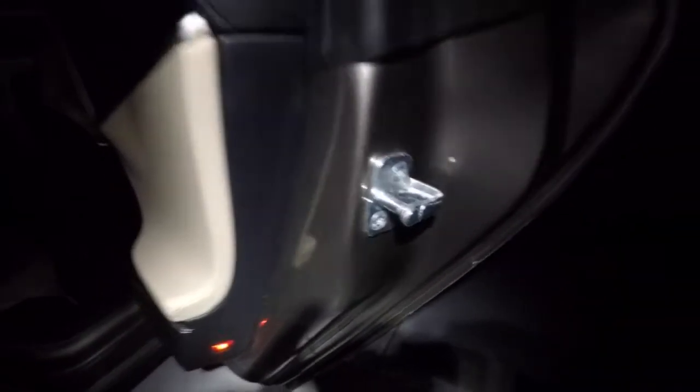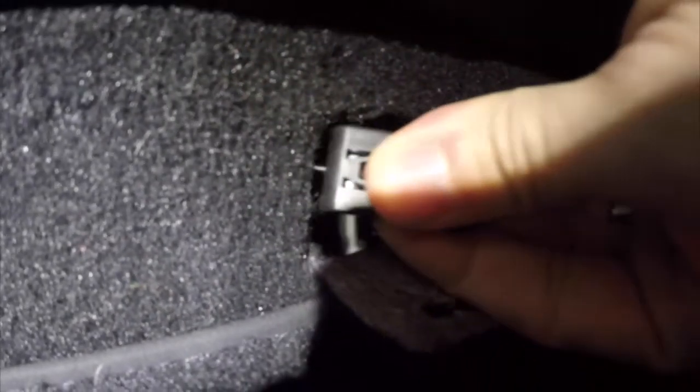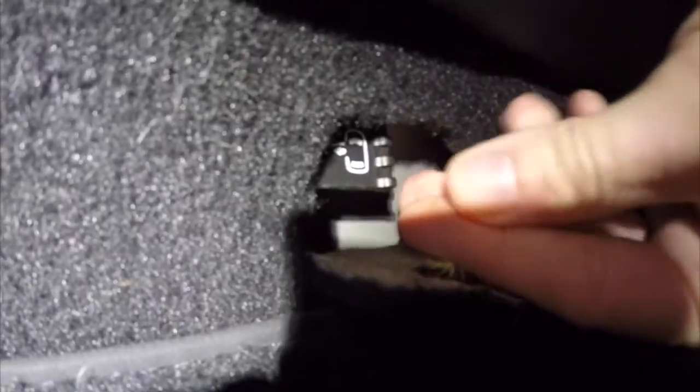As we move on to the back doors, you'll notice that the setup is different. The post is on the door panel and the latching mechanism is actually part of the car body — the exact opposite of the front doors. What you're going to want to do to find the manual release here is it's located directly under the seats in the rear. You'll see this small little tab in the carpet. Right now we're on the passenger side of the vehicle. You'll see this small black tab that indicates this will open the door. In the case of emergency and or power loss, you are simply going to pull this tab. Pulling this tab will manually open the door latch for the rear doors.